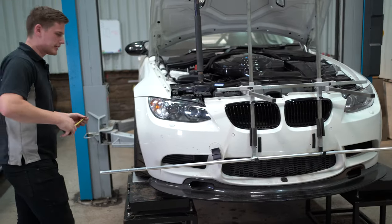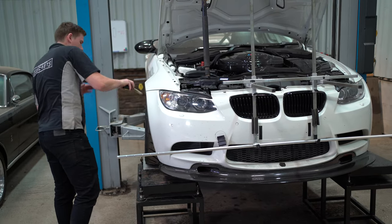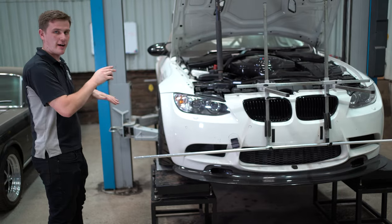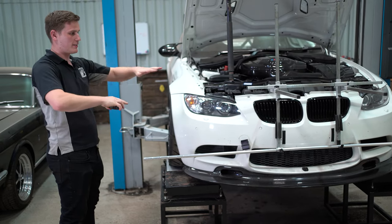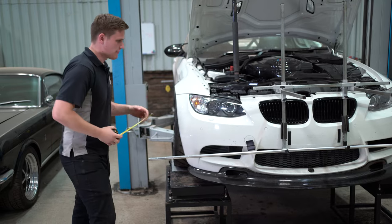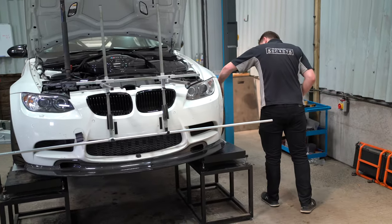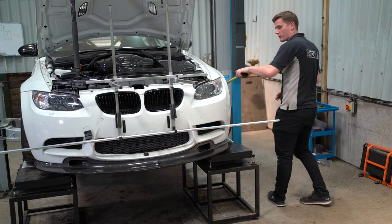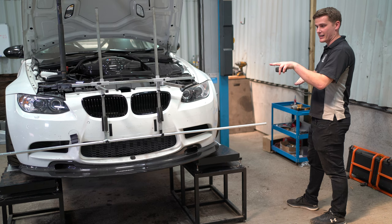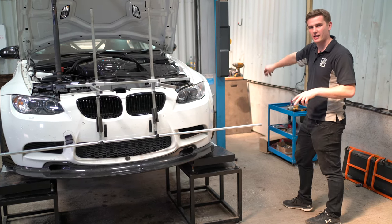You might cycle this quite a few times, getting closer and closer. Also, as you lift one side up it will tip the other side down, so constantly check left to right to make sure the bar is exactly straight, with the same measurement left and right. Once happy with the height on the front axle, repeat the same process at the rear using the bar adjustment to get it exactly parallel and horizontal, so we have a nice string line through the center line of the wheel.